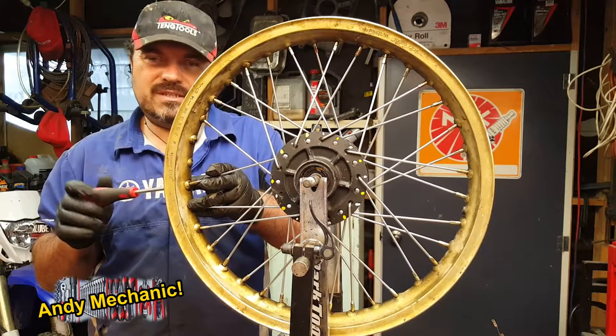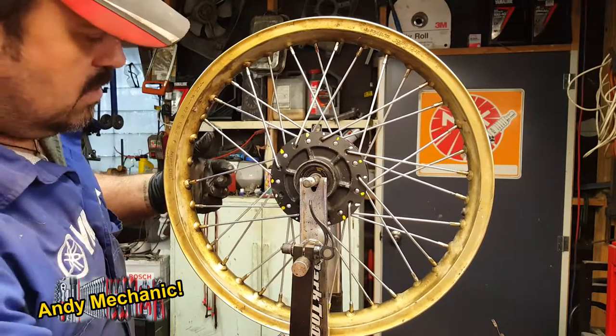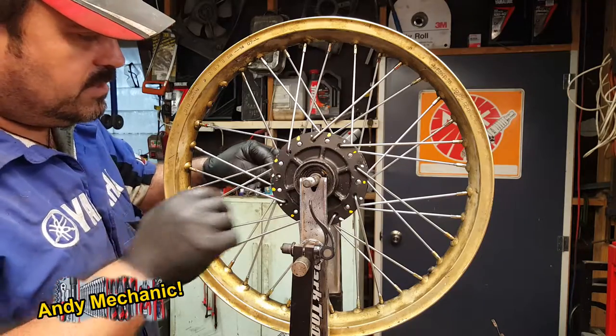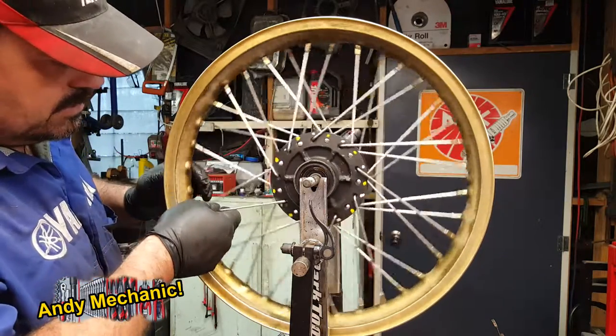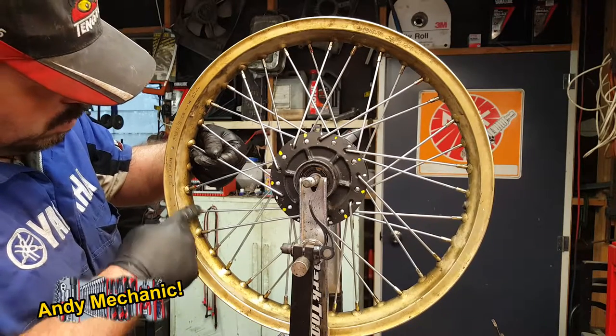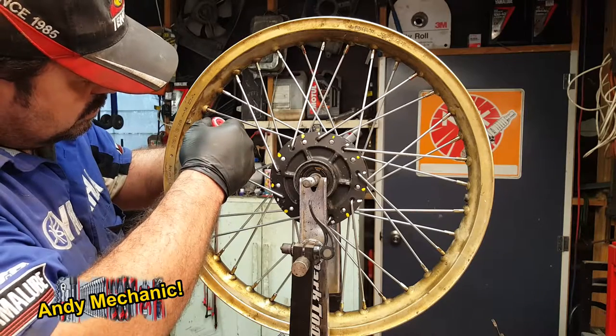So you can even make one of these stands. They're not hard, just because it's a box section. Okay, now the outers. So the outer spokes, they come in from the inside. And that one, well, there's his buddy coming down, so let's count 4. 1, 2, 3, 4. That goes into there, look.